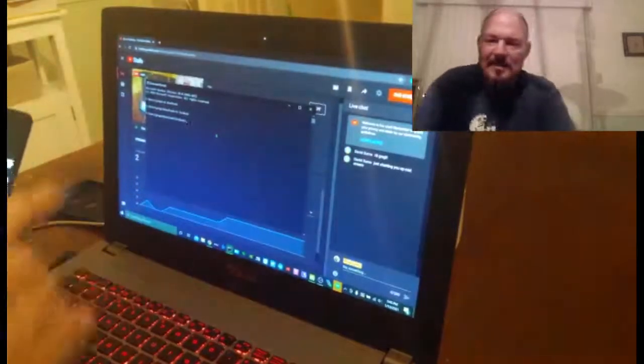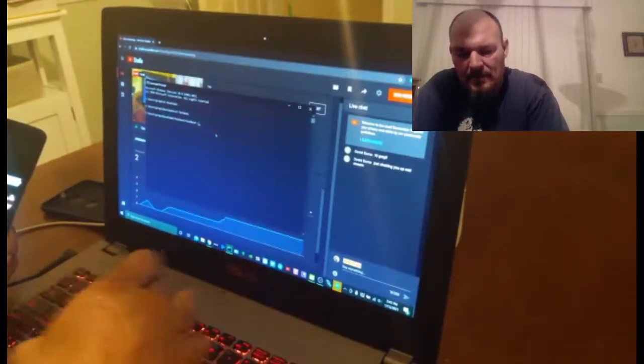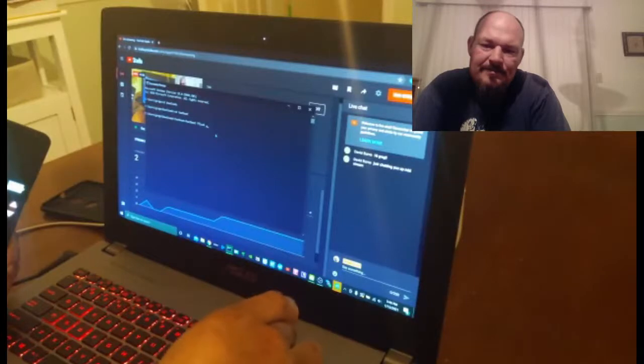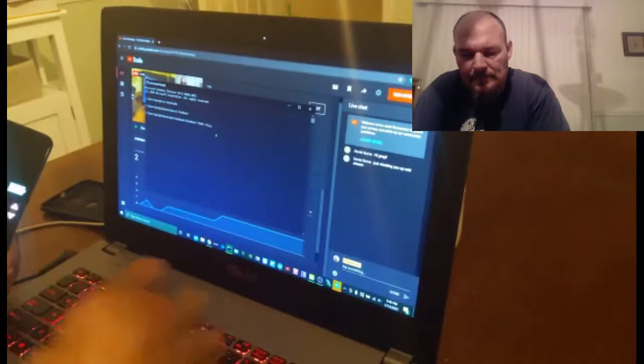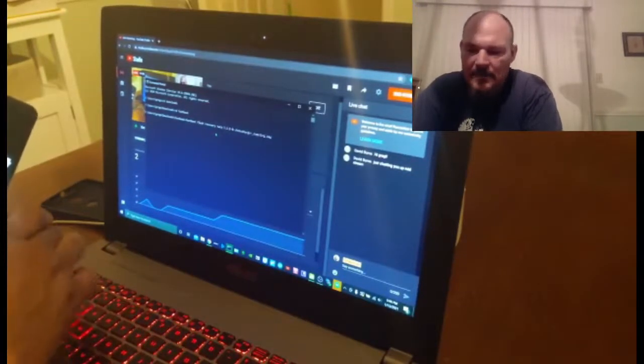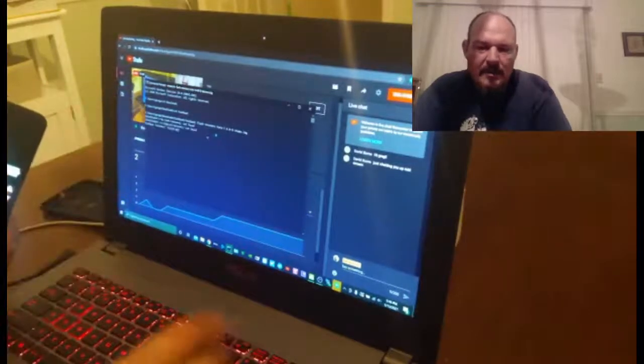Anyway, okay, we're gonna type in fastboot flash recovery. Make sure you type in that. You gotta spell it right. Sorry guys. Fastboot flash recovery, space, TWRP. That's a Shamu, that's the old one. And we'll click enter.